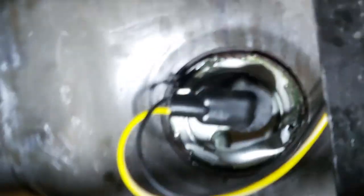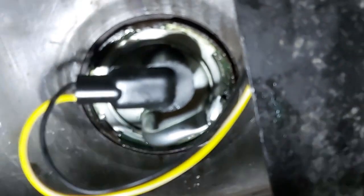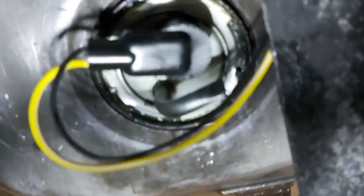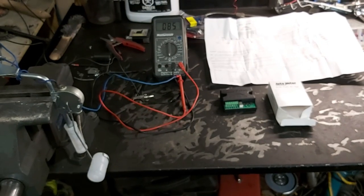Factory tank, modified. That's the Ford Fairmont Amazon sending unit for about $60. I also had to buy a new pigtail from NPD because when I tried to program the fuel bridge before, the old pigtail had no continuity — I thought the bridge was screwed. Got a new pigtail, figured everything out, and now it all works.